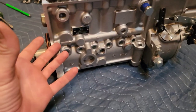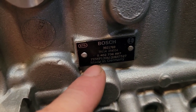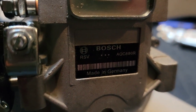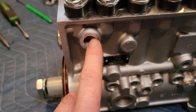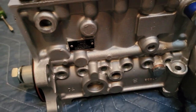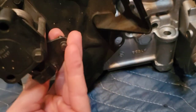Let's start by just looking it over. It came out of the box just like this. Of course it has this tag there that we know is not accurate — Bosch didn't make these pumps in Germany. It's not made by Bosch but they decided to put that tag on there anyways. There's another one on the rear section. First things I notice: if you have a Dodge, it's missing the inserts that adapt it down to M8 1.25 to allow you to bolt the side bracket onto it.